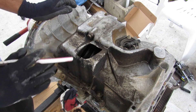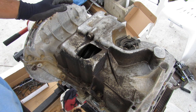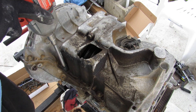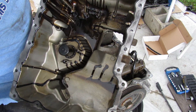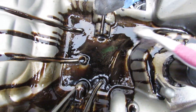There's a giant inspection hole at the bottom of the oil pan — something blew out the bottom here, so we're going to have to open it up to see. By the way, the drain plug is down here and there's an oil level sensor integrated as well. These are E-Torx 10. Removing the oil pan, you can see it's just a cast aluminum piece — and those shiny little metallic flakes in there? That's not good.